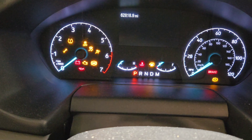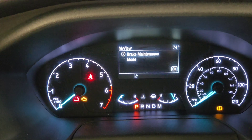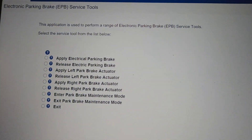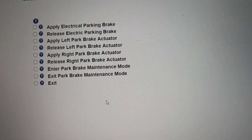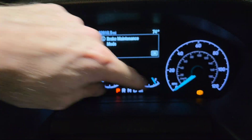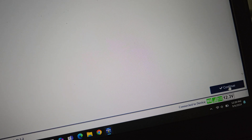I'm done with the brakes. I'm going to turn this back on — it says 'Brake Maintenance Mode.' I'm going to use the computer to take it out of brake maintenance mode. I'm going to select 'Exit Park Brake Maintenance Mode,' and it's going to adjust everything. Continue, continue — ignition on, engine off. So ignition is on, engine off.